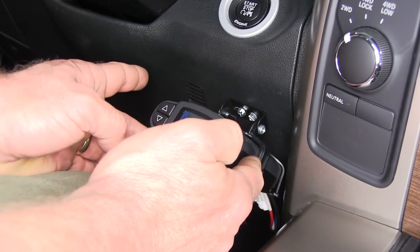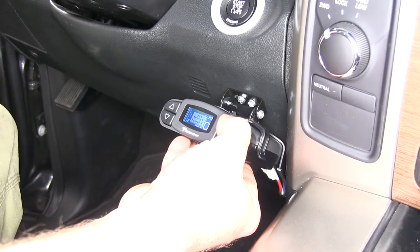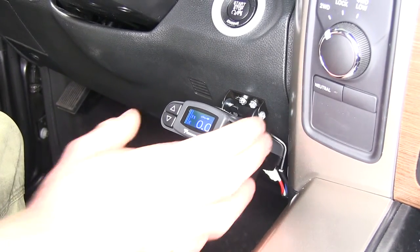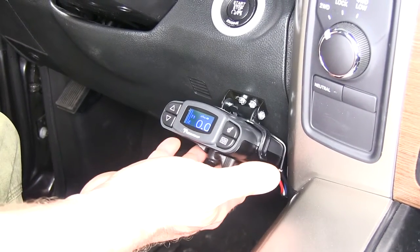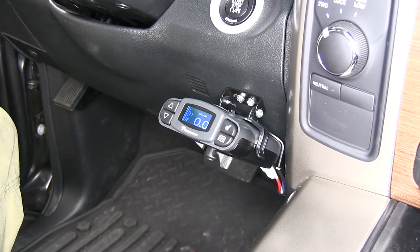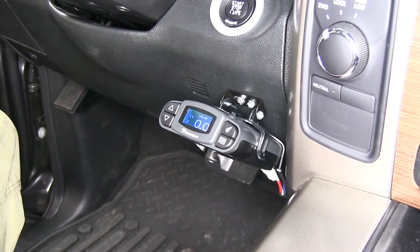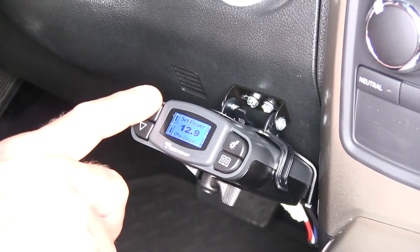It's going to give you a little bit more customization for your trailers or your operators. You're going to have three separate boost levels, which control the aggressiveness of how fast your brakes come on in your trailer, opposed to how they come on in your vehicle. This is a fully proportional system, so the harder you step on your brake pedal, the more it's going to apply the brakes in the trailer. If you run your boost up, it'll come on a little sooner. You can adjust your power levels with the up and down switch.